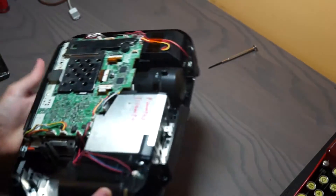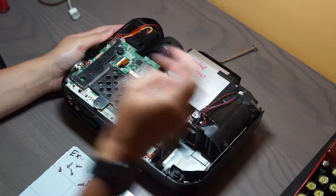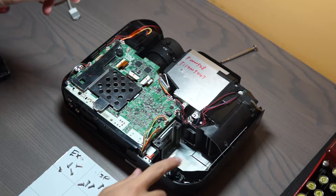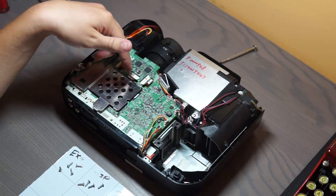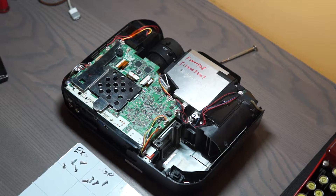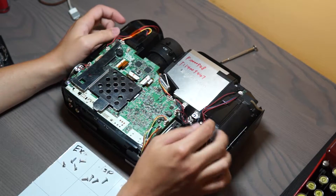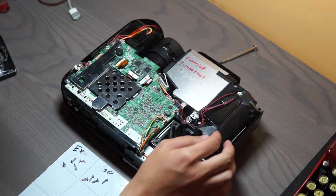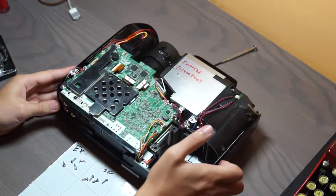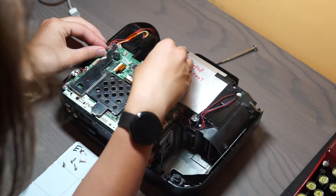Now you get a nice good view of the lens if you wanted to clean it, and this fan which I had to repair previously because this was thrown around. Now we get to the bread and butter of this, which is the main PCB assembly. There are several parts to it involving three ribbon cables — one for red, green, and blue — and this heatsink, connector for the speaker. This is kind of the nerve center of the unit. Removing it is going to be difficult but not impossible, especially because it has all these inputs on the back. There are some screws on the top of the board that are keeping it in place.